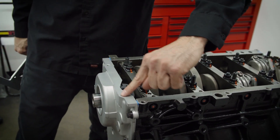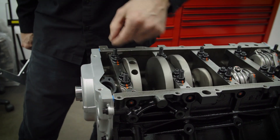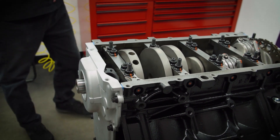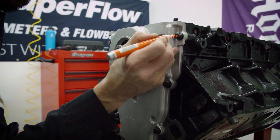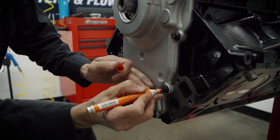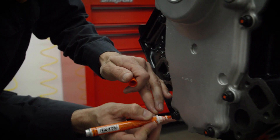This front cover is now flush with the oil pan rail, and that gasket is sitting just a tiny bit proud — that's exactly what we want, so it'll seal nice. Now, just to confirm that we torqued all the bolts, I like to do a little dot, especially with ARP hardware. It just looks nice to have a dot right in the center on all of them, confirming that we torqued all bolts to specification.